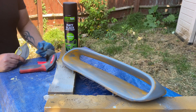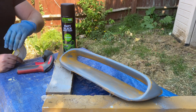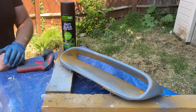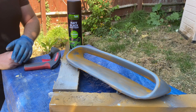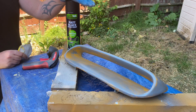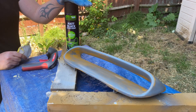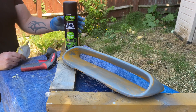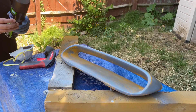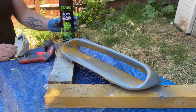Now at the final stages, we've completely sanded the bonnet scoop down - it's all nice and smooth. We've washed it all off and got all the wax and grease off, let it dry, and now we're going to do the first tack coat of paint. It's very important to do a tack coat because you're not going to be sanding this afterwards. Make sure you do nice light coats evenly throughout - it might even be worth practising a couple of sprays on a bit of wood just so you get the right path with the gun.